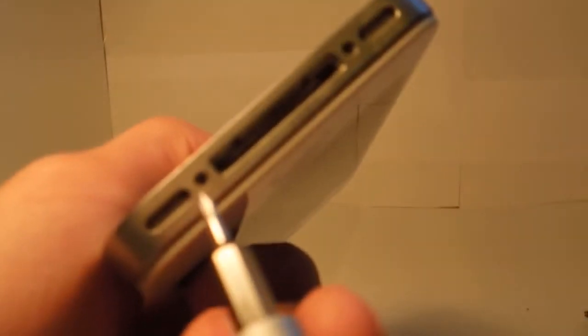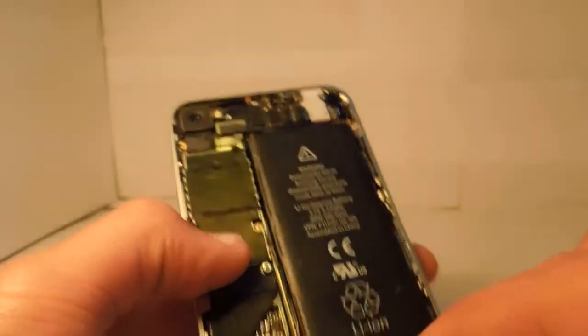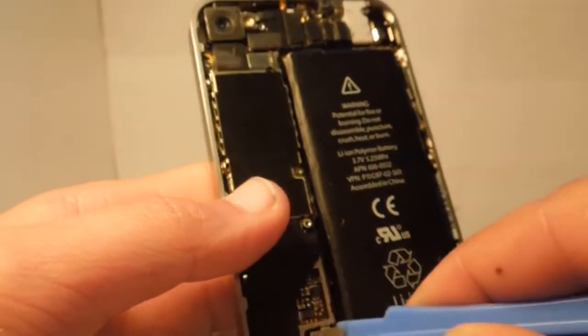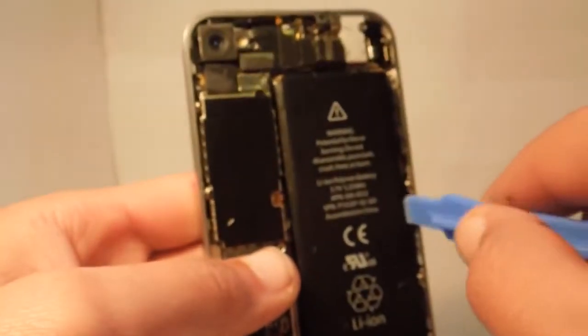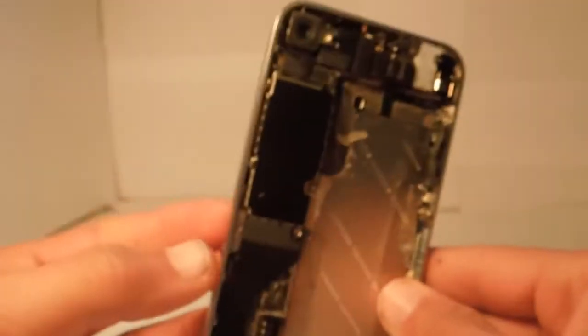You're gonna take off the back by removing the two bottom dock screws, right there and right there. They just use a Philips 000 bit - that's the kind of screwdriver bit that you need. Remove the screw for the battery. Use a spudger or use your nail, it works either way. Don't use the Apple 'authorized repair only' pull tab to pull the battery off - it will sometimes rip, as you can see. It's easier just to use a plastic spudger to take that off.